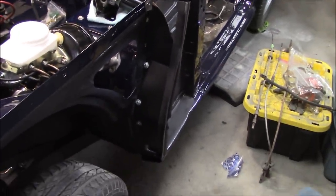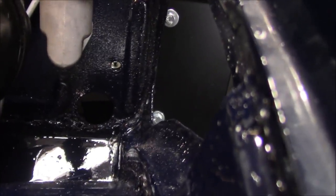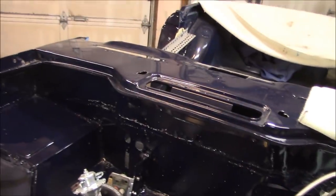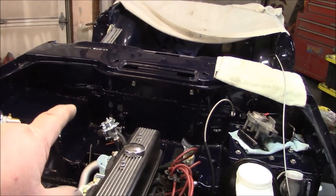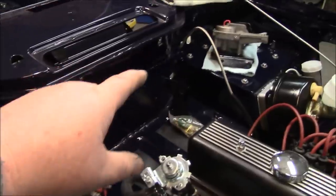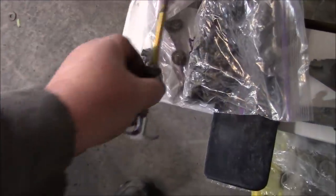Those sealer plates are on and look good — we'll revisit them when the time comes to put that top seal on. We've got the bonnet pull cable to install and the associated grommet that goes in the firewall — it goes through a hole just to the right of the clutch master, then has a strange routing across the top of the bulkhead to where the catch will be. I've got two little fasteners on the bulkhead ready to capture that cable. Then I started thinking about the catch plate, which I hadn't seen in a while — it mounts over here and that cable hooks up to it, and it has not been refinished yet, so it'll be blasted and painted tomorrow.